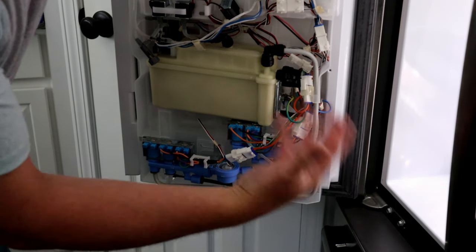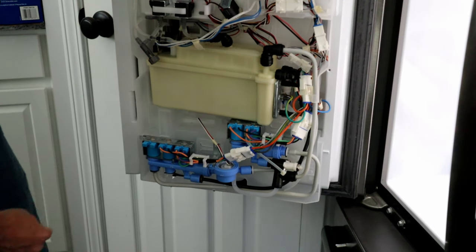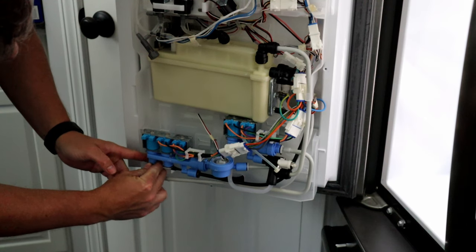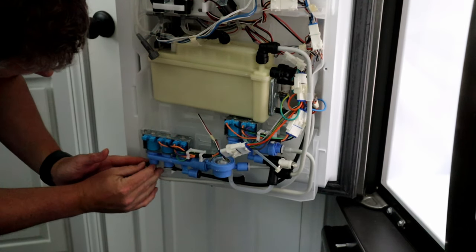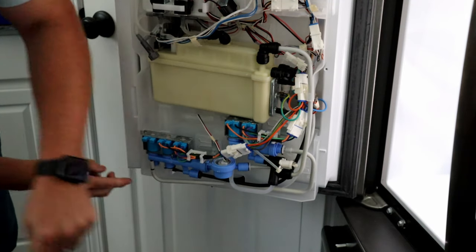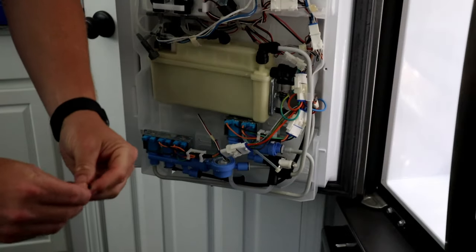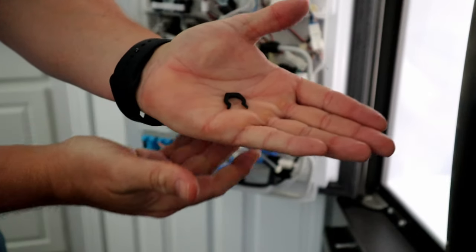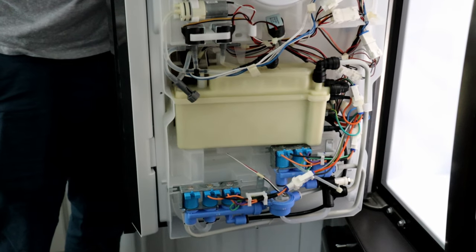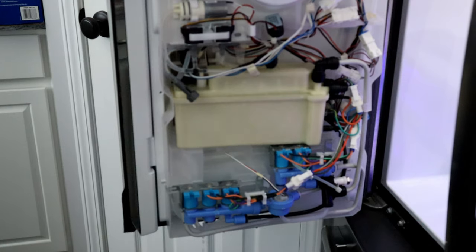Just to prove the relay is activating and we're getting water from the supply line through this meter and through this triple valve here — I'm going to take off this little clip. It just slips right off with your finger. It's a little black clip from the water line on the third valve. It should be the valve that's active. Then press up into the valve and release the water tube. I'm going to tuck it back there. What we should see is water spraying out of that valve when we press start heating. And it does — so it's blowing out this valve here.